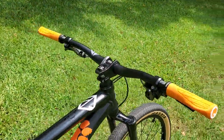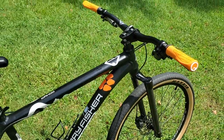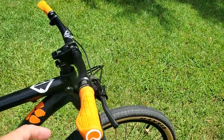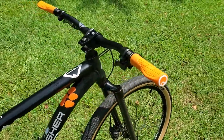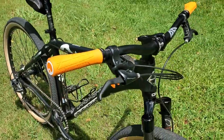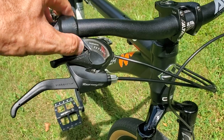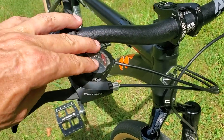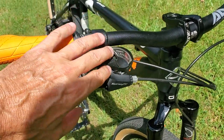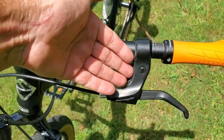I put the flat bars back on it — she just prefers flat bars, which is fine. I had some wide gravel bars on it and those were fun, but she's more confident with the flat bar. I put on some ergonomic grips for comfort, and these levers and shifters came off my son's bike when I upgraded his. His was a 3x8, so you'll see there are 8 speeds, and the shifter and brake lever are integrated together, which is fine for the rear.